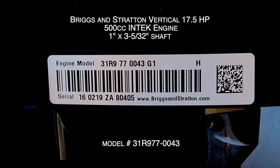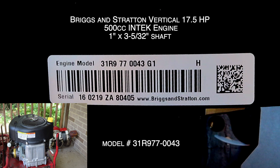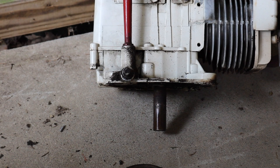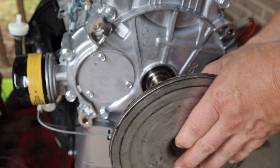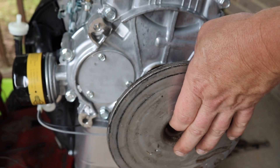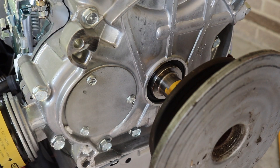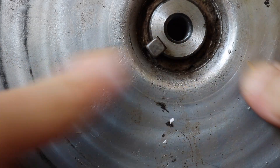We've got the new engine — let's check it out. Looking at the shaft of my old engine, you can see where the clean versus dirty area is. I'm going to measure that dirty area and make sure my new shaft is set at the same height. This disc goes on like this, and I've marked the location. Make sure the two notches line up — there's a notch here and a notch here. I'm lining them up so it's exactly where it was, then tightening with an Allen wrench. The shafts were identical — most of these shafts are the same. Now the key has to go in right here.